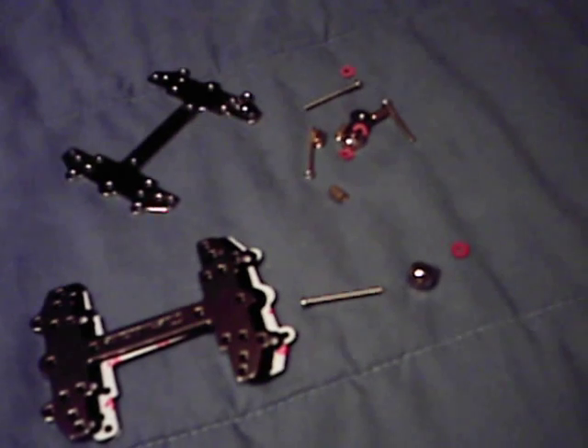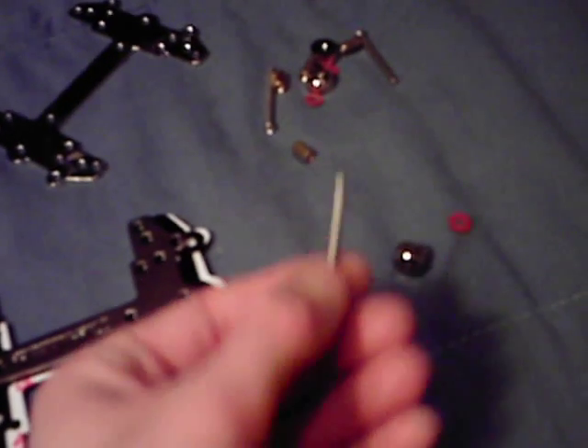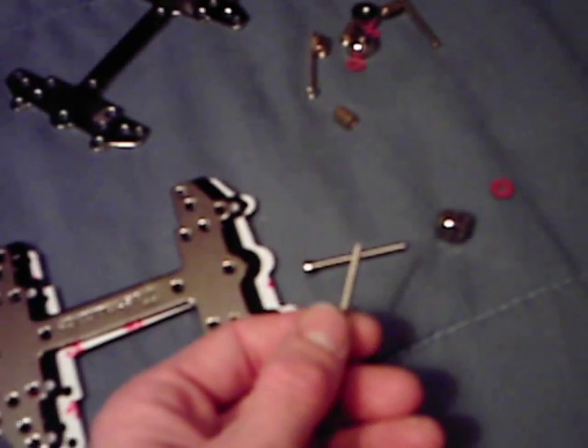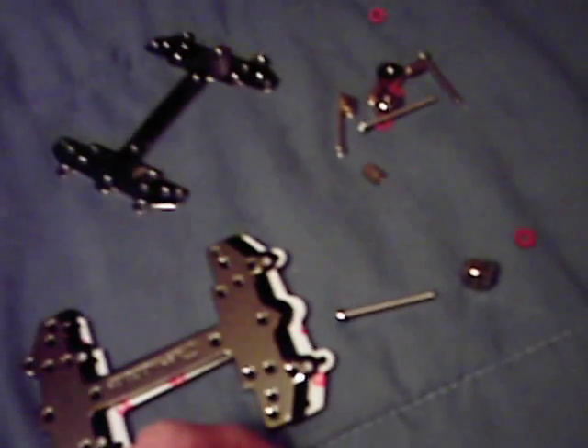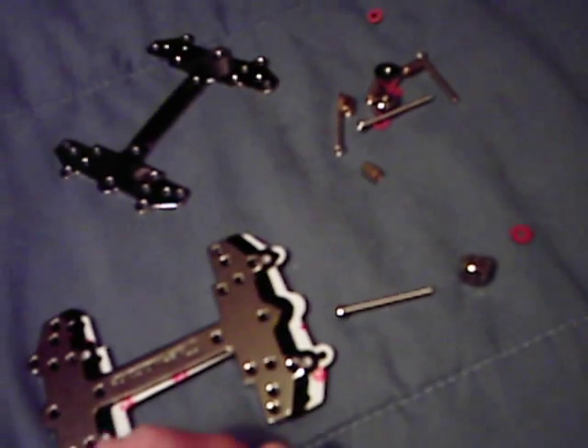The one thing I do not like about this heat sink is there are no springs on the hold-downs and no stopping point — these screws go threaded all the way down. For someone who has never installed a heat sink like this, you could damage your motherboard. Basically, just tighten it down hand-tight, maybe a quarter turn more on the risers. When you get the heat sink mounted on there, just hold it down with the weight of it.